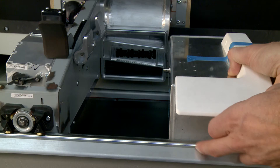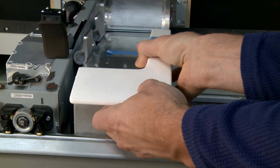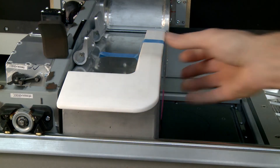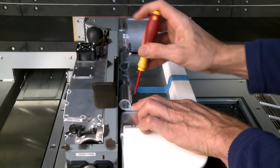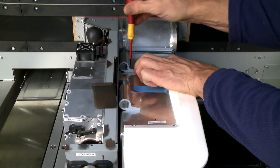Folding the new lamp module, align it with the features on the fusing carriage and rotate the front hinge to insert it into its slot. Tighten the two screws to secure the lamp module to the lamp hinge. Repeat the process with the rear hinge.